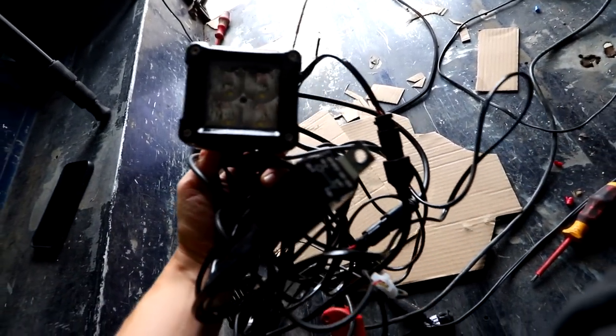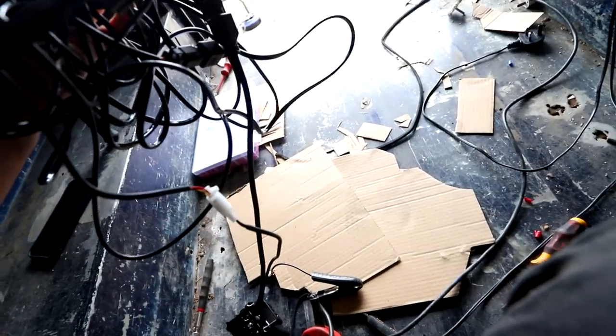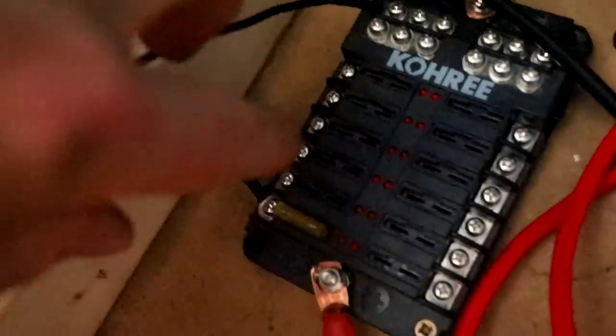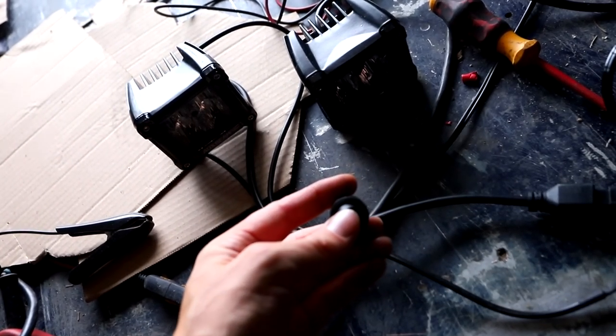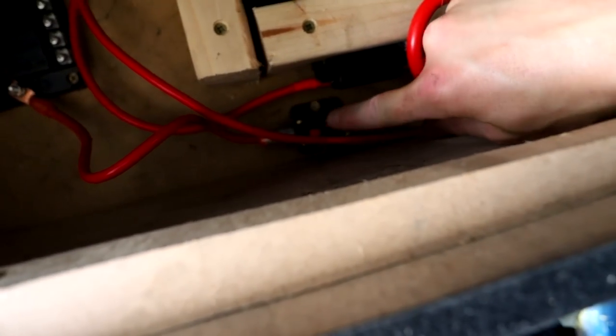I'm just going to test the fuse box. I have some lights here — this is next video's job because it's a big job. We've got some aux beam lights: four for the front, two for the sides, two for the back. I'm just going to wire this to the fuse board and see if it works. Positive goes in, whack a fuse in, negative there — hey, it works! Now we have something wired to our aux battery. I want to use these lights when I'm parked up camping without draining my main battery. Watch — I flip this breaker and that isolates the whole fuse box. Turn it back on and lights work again. These actually look pretty sick — very stoked to get these on top of the truck.